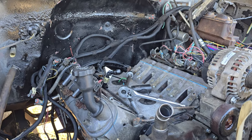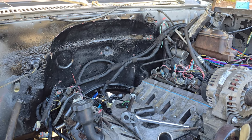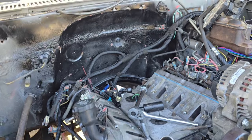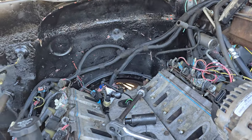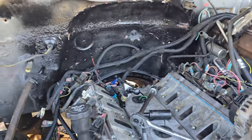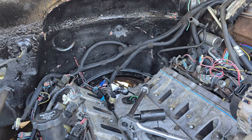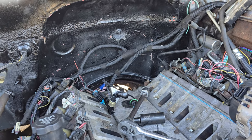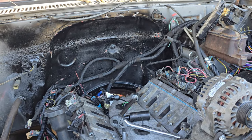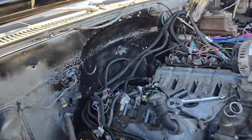Well, I don't know exactly where I lost you, but my phone overheated and died. I got all of my wire loom done. I started on my gauges, went to go and put in the oil pressure sensor all the way in the back. That was not fun. As you can see, I had to take the intake off, had to get a 27 mil socket, had to bust the top of it off to get it turned out of there. Man, was it tight. But it's out.